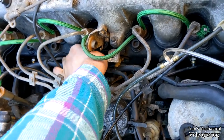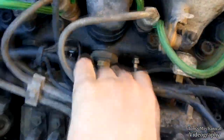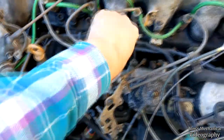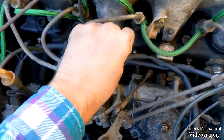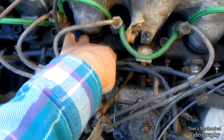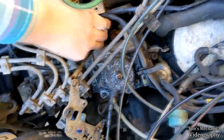Yeah, I'm just threading this whole thing in by hand, the whole damn way. See, that's seated. Watch, that'll probably be not even a quarter of a turn to torque it. Yeah, there it is. So, interesting. This one's also probably the easiest so far. Oops, did that backwards. That's all the torque I'm giving it, probably 20 foot-pounds. Intriguing. Oh no. Oh, I see it. Thank the Lord.